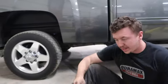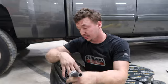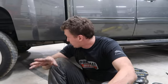So, right now we got a 15mm and we're taking off the 4 bolts between the cat and the DPF, I believe, or maybe after the DPF, I don't know. Like I said, all the sensors are unplugged. There's a few things I want to show you underneath once we get everything out so we can talk about it. But yeah, we should have the exhaust off here shortly.